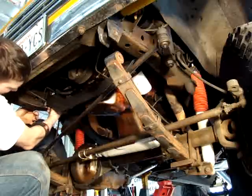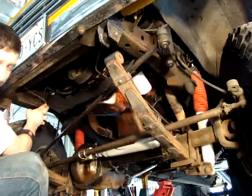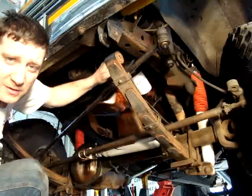The nice thing about our straight steer braces is they're half-inch steel, and the corners are welded so there's no fatiguing. We also have this cutout right here which clears the radiator — you can see if we didn't have this cutout, the radiator hose would be touching.